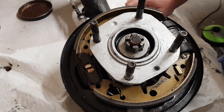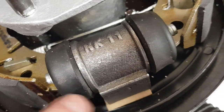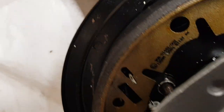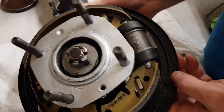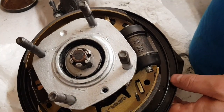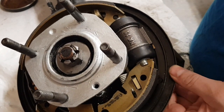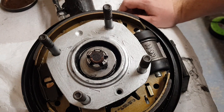Got there in the end - as you can see it's all done up by the springs. Just need to make sure these bits are all lined up before the drum goes on. To check that you've got it, if you manoeuvre the handbrake you should see these moving out - and then you know it's all set up correctly. Not my most favourite job, but one of the most important jobs.